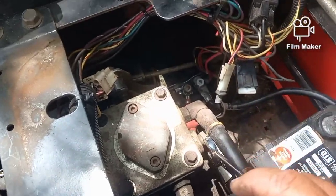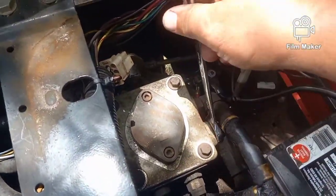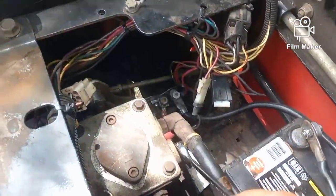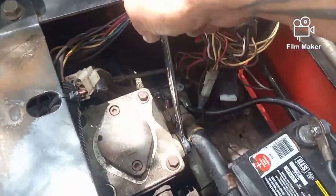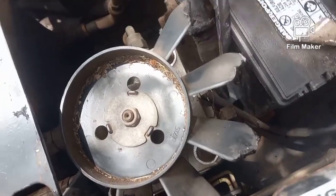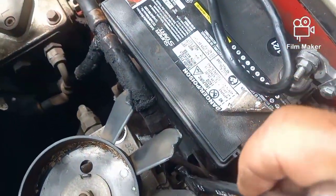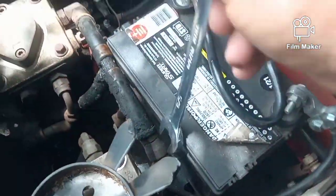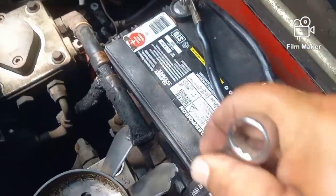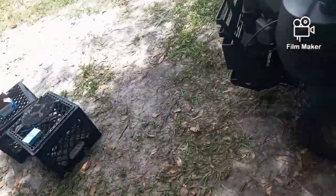Just don't pull the bolt all the way out, and there's no bleeding needed afterwards — it literally just allows the fluid to roll freely. On a commercial mower there's actually a hole in the head that you can feed a small pin or screwdriver through, but I just use the 5/8 box wrench because it's a little stronger. Tighten it back up and the pumps are re-engaged.